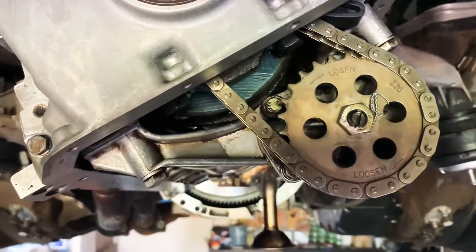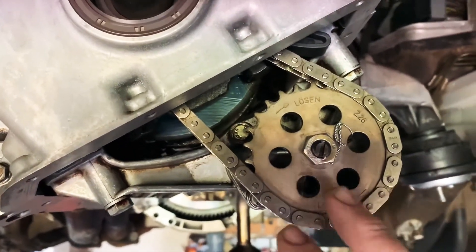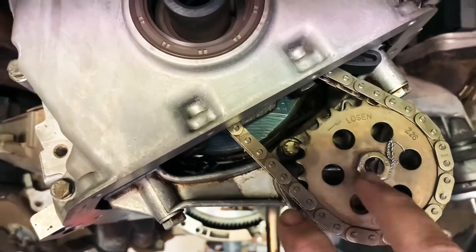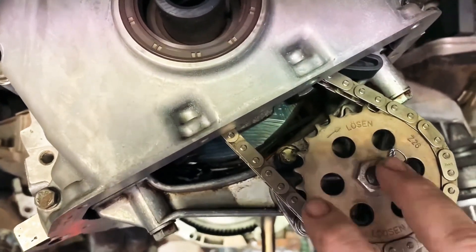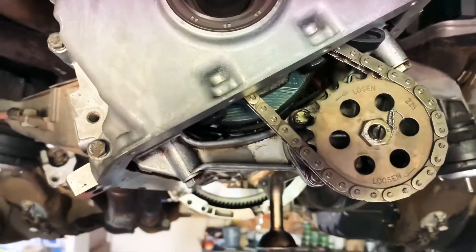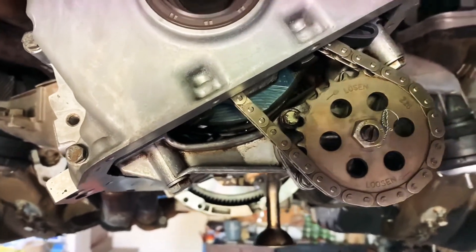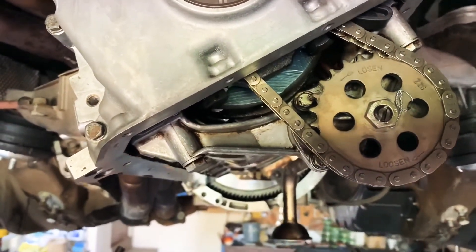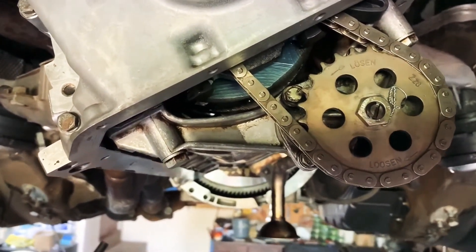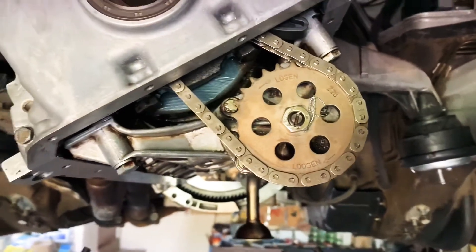So the question is, if those harmonics are there, you basically have one of two options. One is to completely upgrade the oil pump assembly — upgrades are available but they're hellishly pricey, involving different hardened shafts with three external bolts as well as the center bolt, and a range of different upgraded pumps. My approach is to rather look at what those harmonics are, whether they're all necessary, and whether some are a result of the age of the car.